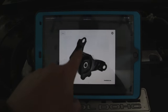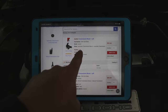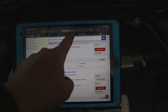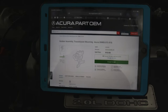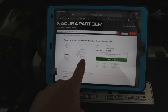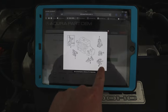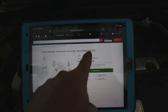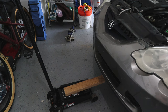There are a couple of aftermarket mounts available for a reasonable price if you're a parts geek type of guy. Make sure you get the one for your particular transmission — this is an automatic transmission. The OEM part is also available but there's a big difference in price. The OEM part is number seven on the diagram, and the part number is 50805-S7C-013. It's called the rubber assembly transmission mounting.